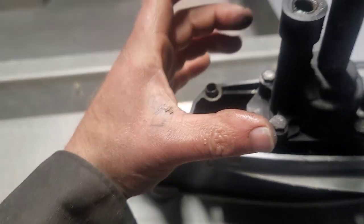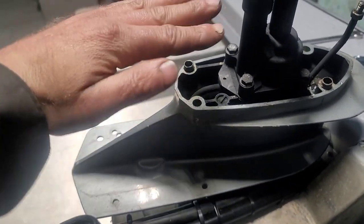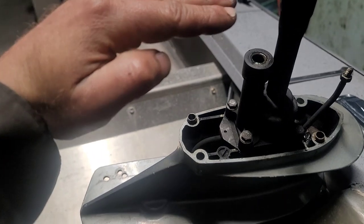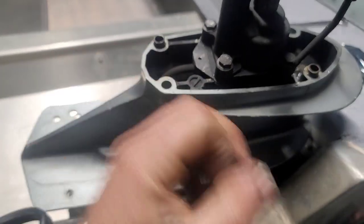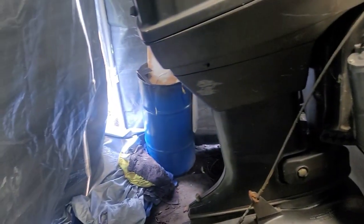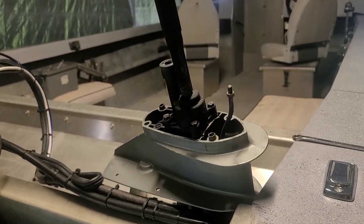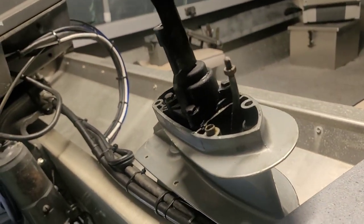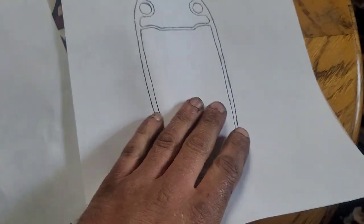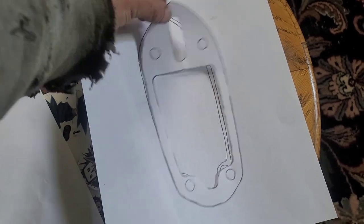I'll make an additional piece that matches it to go up above it, then bridge the two flat bars together — one here, one here — about seven inches apart — and weld it all together so I can access the bolts, drill and tap, or whatever it takes to make an adapter for the housing. It's got to be stupid strong in case you hit a stump, but really quarter-inch would be more than adequate. I'm thinking an extension on this shaft is something I can probably fabricate — let's see how it goes.